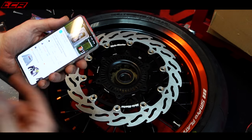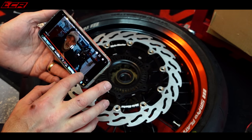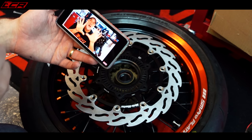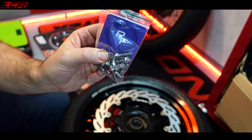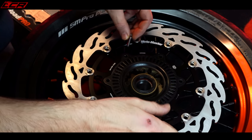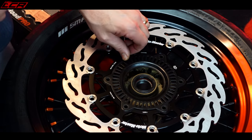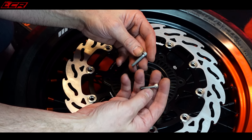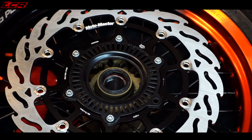Bloody adverts on YouTube! So now you're watching Lamb Chops watching himself in another video — it's like Gogglebox. The front wheel: that little bit points in, and that little bit's under the disc. It's not looking hopeful for remembering how the Ducati goes back together. Annoyingly, my titanium disc bolts are a little bit too short — there's not enough thread to put your life in. The standard disc bolts are longer, so I need to get a slightly bigger disc bolt. I'll put the standard ones back in for now and swap them later.